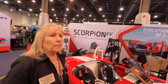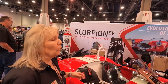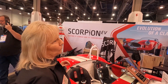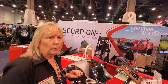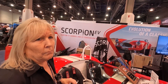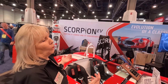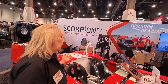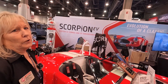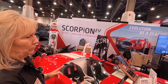It's a little complicated because it still has the manual, but roughly — horsepower and torque — we're right at around 200 horsepower and a little over 230 to 240 pound-feet of torque. Overall weight is 2,600 pounds. That's not heavy at all — it's nice and light. This car normally gets built at around 2,450 to 2,500 pounds, so we're about 100 pounds heavier, which is really nil. For those of us who race, you can transfer weight all over the place.